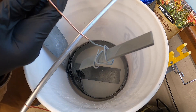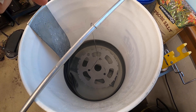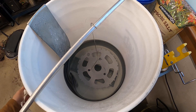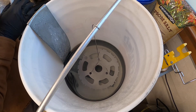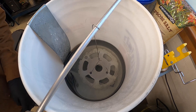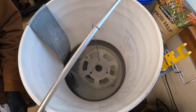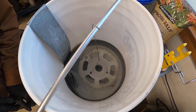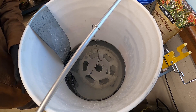I think that's a successful test. Now I need to actually do the trigger wheel. I rinsed and washed the trigger wheel, made some space, and made sure it's not going to touch any of the zinc. I'm probably going to do three or four coats. I kicked it on — it's already changing colors! It's not going to be perfect since I may not have gotten it perfectly clean, but after multiple coats I think it'll look pretty good. Really I'm just trying to prevent rust since it's exposed to the elements outside the engine.